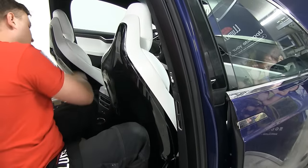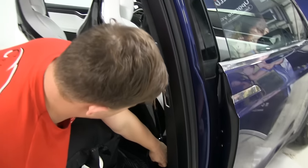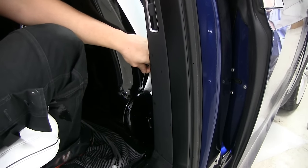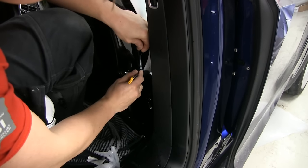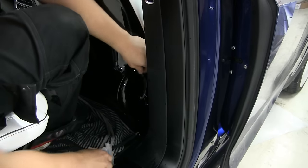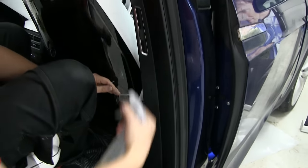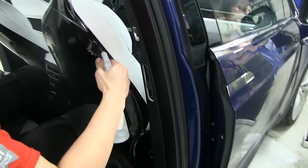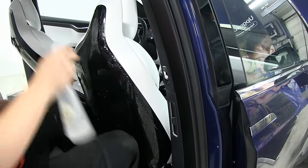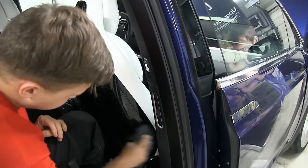Part of the tape. Now once we remove the string from the knifeless tape here, we have to remove it. Small problem here. When we're removing this, because there was a glue and there is like excess oils here, we have to pull to our side and spray the alcohol solution here. Then we have a nice clean edge, which will stick permanently there. All the way. Now once we're done, take our squeegee and microfiber and just finish everything to the place.